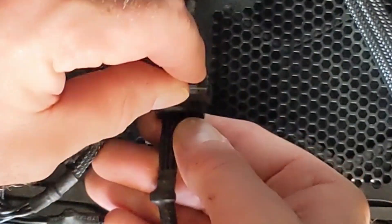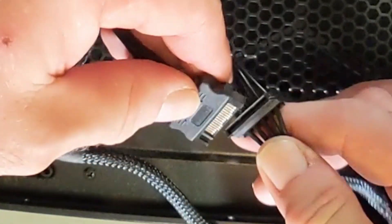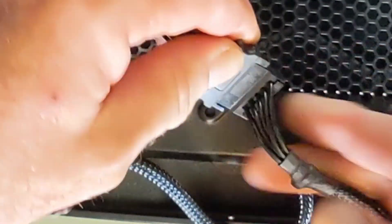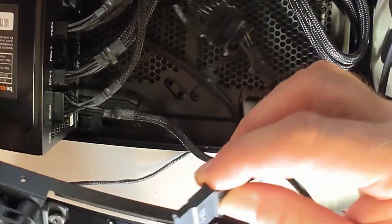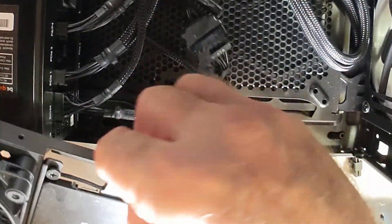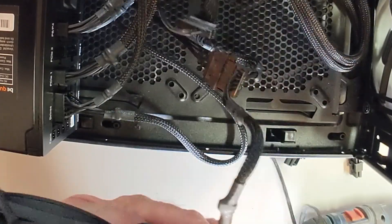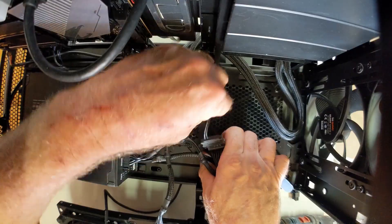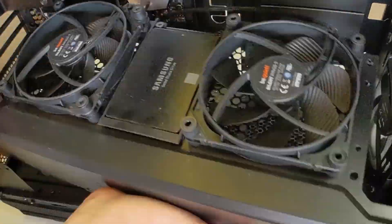When you need to disconnect them, you'll have to pull as you wiggle them gently to aid removal. This particular drive cable had three SATA connections on it — I use a third for this SSD that fits onto a PSU shroud. This SSD will now be powered by the SATA cable from the PSU and will also get a data connection from a data cable. Now I bundle this set of cables together to reduce interference with airflow and to reduce clutter under the shroud. Some folks use zip ties — I like the Velcro wrappers that Be Quiet includes with their hardware.